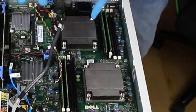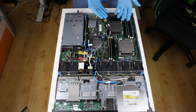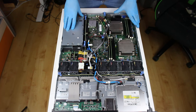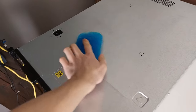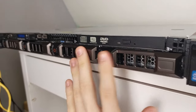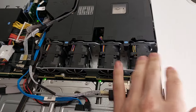This is a two CPU machine. But wait, CPU heatsinks usually have active cooling or fans on top of them. Well, that's another huge advantage of the rack system. You may think that cooling a literal slab of metal with two CPUs inside of it might be a bit hard, but it's actually quite simple. You see these vents on top of the hard drive bays? Those are your intake, and the sucking is being done by these fans right here.